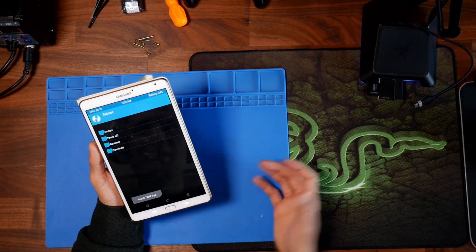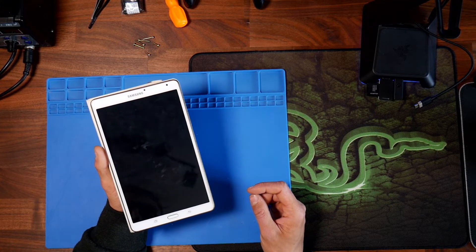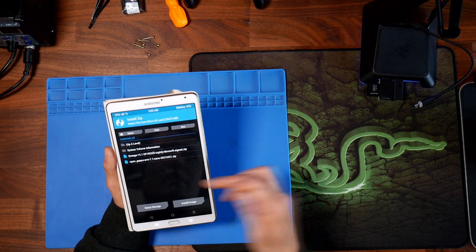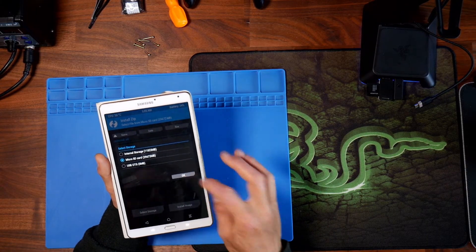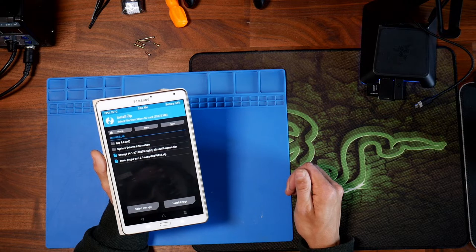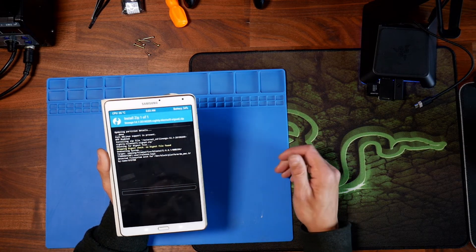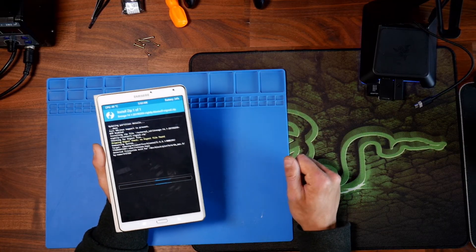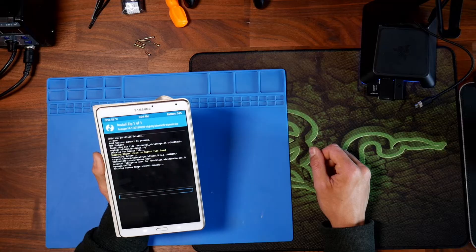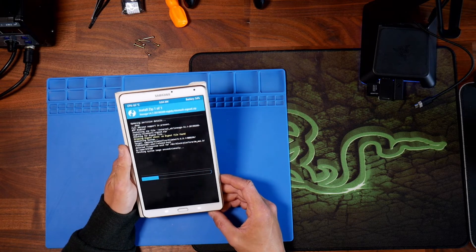If you've just put the SD card in you may need to reboot — make sure you reboot back into recovery mode. Once back in recovery, click Install, select your storage as the micro SD card, and you'll see the two files: the Lineage OS and the Google Apps. Install Lineage first. If everything goes correctly and you have the right file, it will go through. It will show an error if you have the wrong version for the tablet. Don't touch anything and don't turn it off — let the ROM file install. Then do the exact same thing for Google Apps.